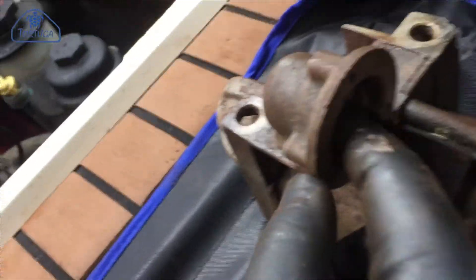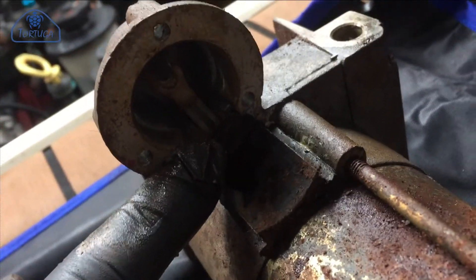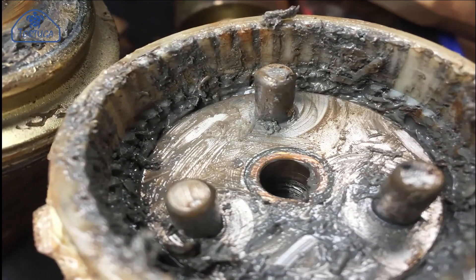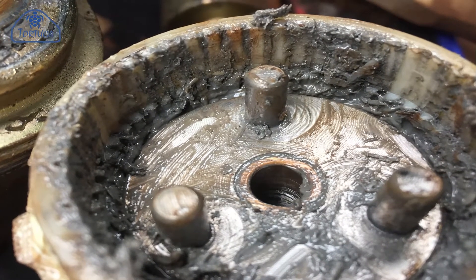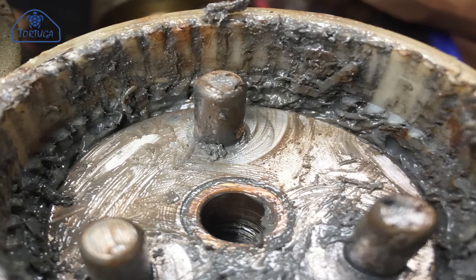As the engagement mechanism was in good order, I opened up the gear case inside the starter. Here there are three small planetary gears that should engage in the outer gear ring. As can be seen here, the plastic teeth of the outer ring have been completely stripped. This is why the starter was spinning but not turning over the engine.